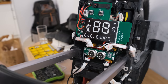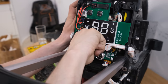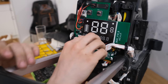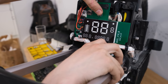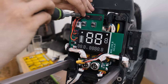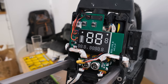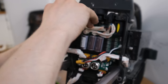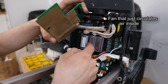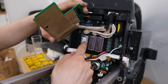This display is nicely readable — maybe not in extreme sunlight, but it's a great feature. Next we disconnected the main battery connector and turned the wheel on for a second to discharge the capacitors. We did that so we could unscrew the single — yes, one single — screw that holds the top motherboard in place and see what's underneath. Underneath there is some sort of weird tape beneath the motherboard, and three hefty capacitors whose values we don't really know because of how they're positioned.